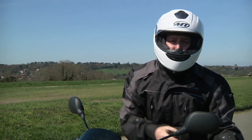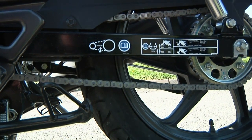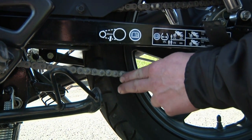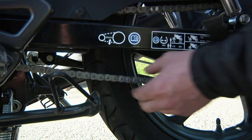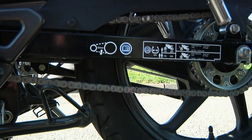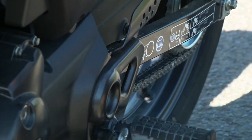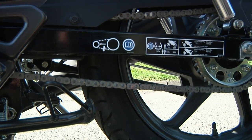So now I'm going to give you some maintenance tips about checking your oil and adjusting your chain. The measurement on the side is about 20 millimetres — if you work it out, that's about two fingers. That's on the slightly looser side. Obviously check it a few ways round, but it's important to keep the chain lubricated, and make sure you check your tyre pressures.